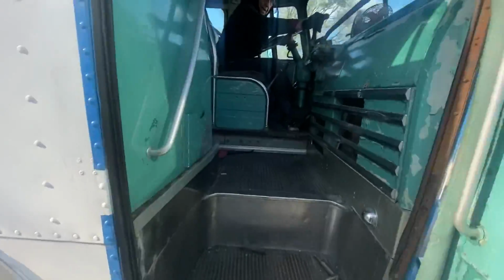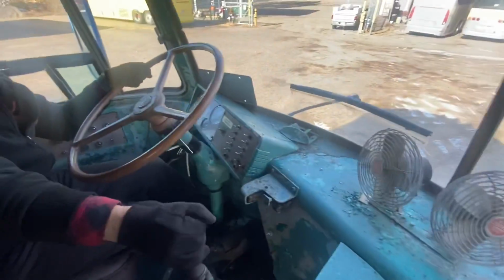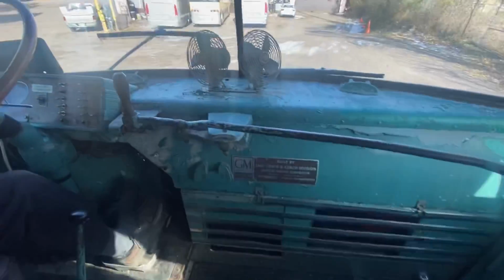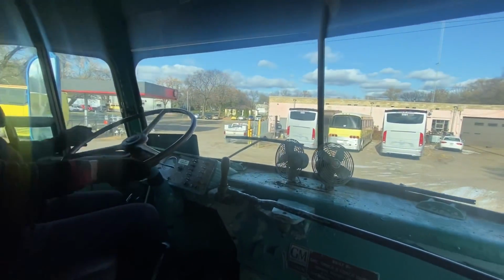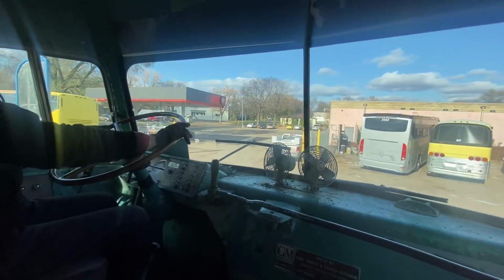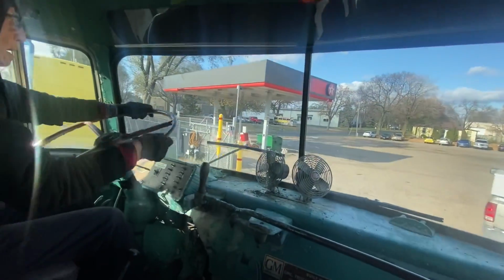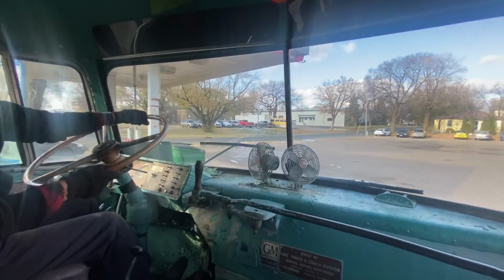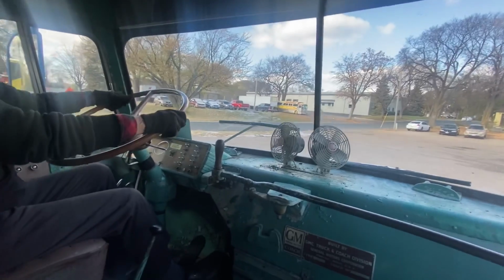How'd the brakes feel? They good? They're releasing? Kind of. Yeah, the light is off. They're released. I put a new switch so it engages at about 6 ounces of pressure. You notice one injector wasn't firing until it warmed up a little? Yep. When I heard it start, I was like, oh God, it's missing again. And then it kicked in.